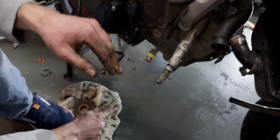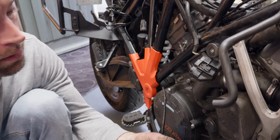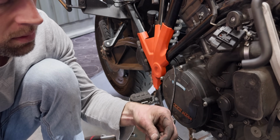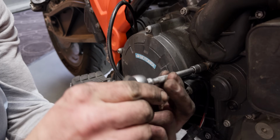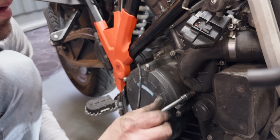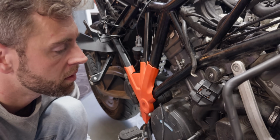Okay, so there's one screw that's going back, and that's the drain from the underside of the water pump that we used with the washer that's going back in there. This is going to be renewed when the engine gets set in. Because they put it on a test stand, they want that to be tight. So that's going back in.